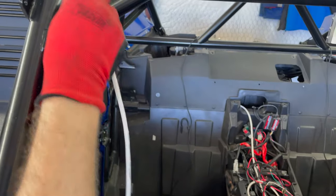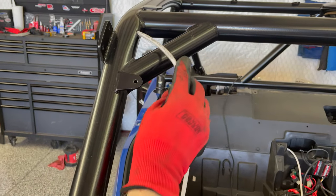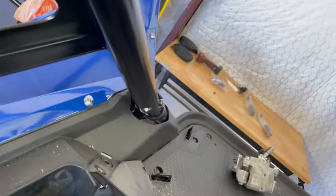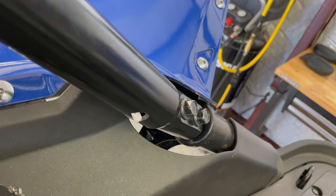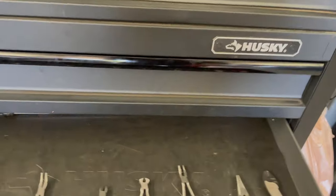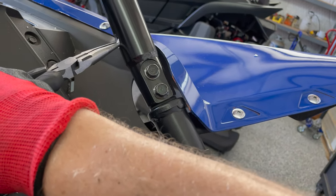It's just good wire. It's not designed for cars or for automotive use, but I've always used it, and I like it. So as you see there, all I did was just push it back, and it's already hitting down there. And as you can see, whoop, there it is, coming out of the hole. So that made it nice and easy. This wire is stiff enough that you can just push it. You don't have to use a fish tape or something like that.